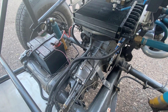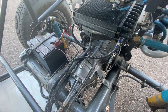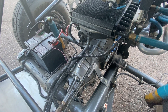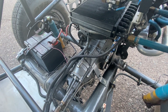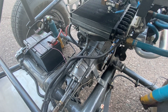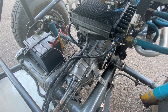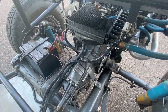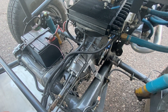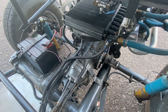You can change the gear ratio very easily — run a taller fourth gear out of a Volkswagen Bus (0.82 ratio) for a freeway flyer. You can also change the ring and pinion in the transaxle. Right now it's either a 4.12 or 4.56; change it to a 3.88 for a taller third and fourth. A double freeway flyer setup with all four gears from a VW Bus would drop it down to a 3.12. But right now it's geared super low — great for corners and drifting.